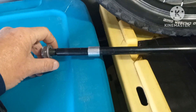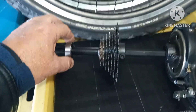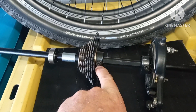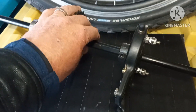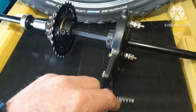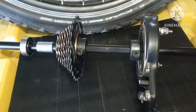These things are pretty easy to take apart — I'll give you a quick rundown anyway. Just pull off the wheel nuts, which are 22 millimeters, and pull off the washer. On the left side, there's a small spacer that goes between the wheel and the outer bearing. The inner bearing here I have off because it's kind of crunchy, so I'm going to replace it. Inside there's a longer spacer between this bearing and the freewheel. Both the freewheel and the band brake are held on by these 5 millimeter Allen bolts. The outside of the band brake's easy — pull off the cable with a 10 millimeter, and the two bolts here are about 10 millimeters with this one being 8 millimeters. Once you have all this loosened up, just push on this side, run the axle through, and everything just kind of falls on the floor.